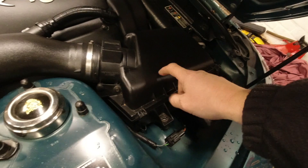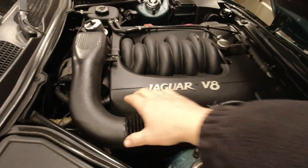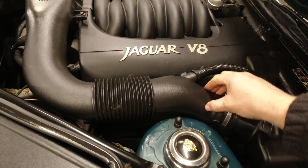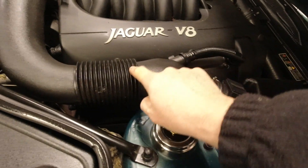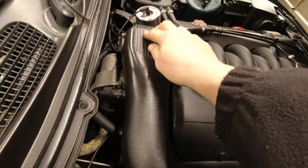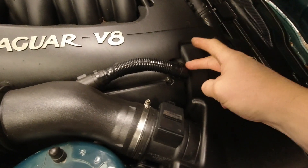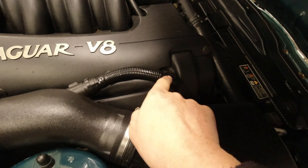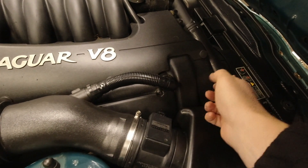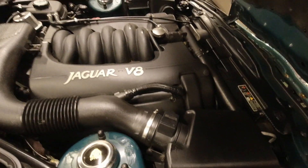This trumpet is plastic and relatively rigidly mounted, with a rubber mount here. The engine moves, so this is constantly twitching - hence the concertina section. This needs to be airtight. Check the joins, check the seals, take this off, shine a strong light in it, look for pinholes, and make sure it's mounted properly with the seal intact. Check that your breather hoses are connected, not leaking, have no air holes in them, and are not blocked.